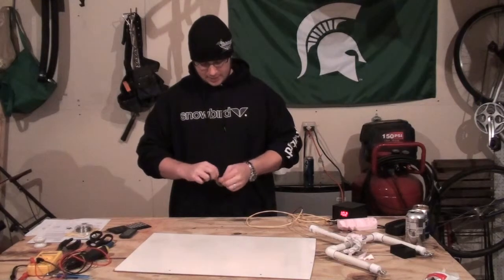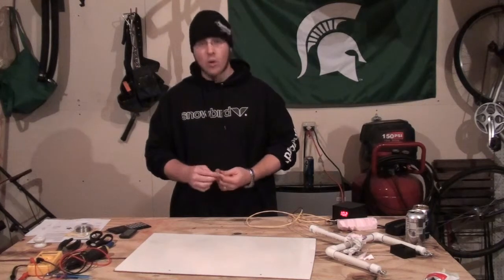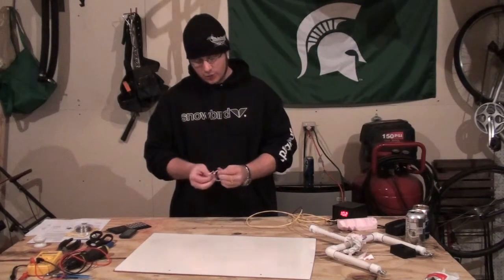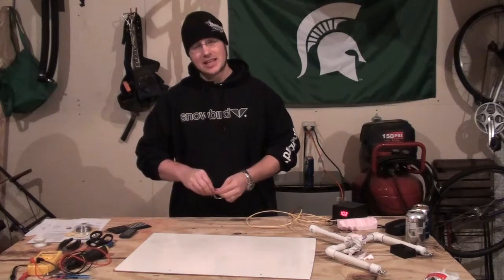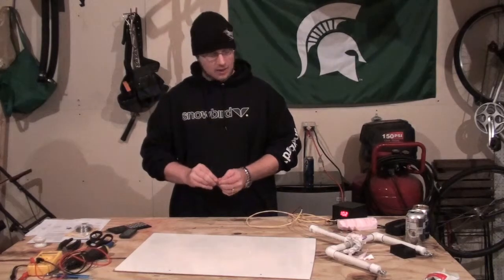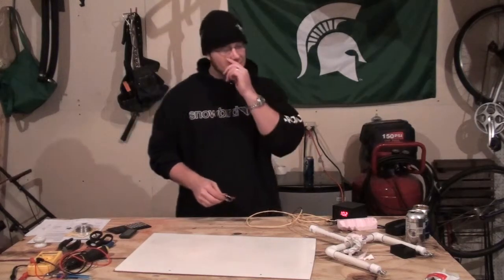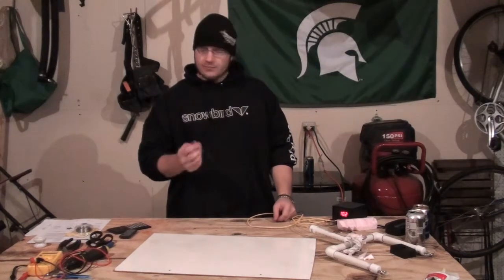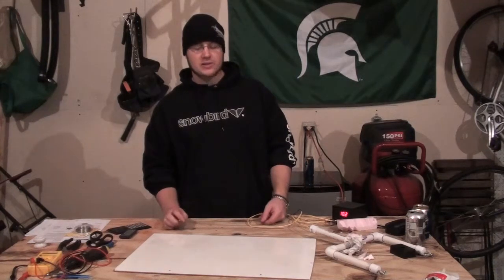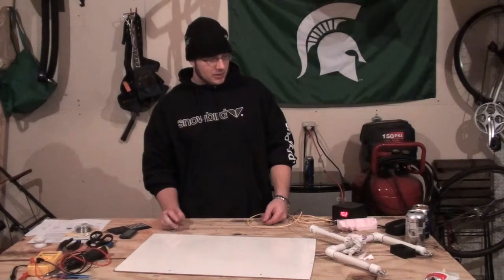If you don't want that big thing dangling, just find some wire that's actually coated. Most of the coated stuff I found was 18 or 19 gauge, which is probably going to be too large a diameter to get much resistance. But it never hurts to try. If you still have your power supply clipping out, just put more length into your resistor and increase the ohms of your whole circuit, and you should get it to work pretty well.